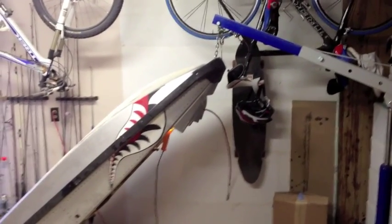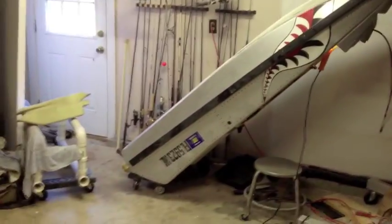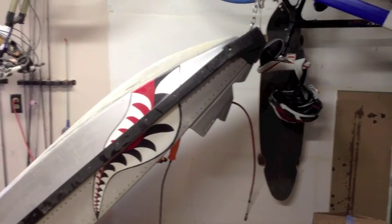I just wanted to get a quick shot of the rig I used to reinforce the inside — what would normally be the bottom side — of the handle pole bracket mount on the hull. I basically hung the hull upside down off of my engine hoist, put a furniture dolly under the stern of the ski, trying to get the surface as level as I could so I could do the best layup. That way I could sit on a stool and sand in there to get it all smooth, then lay the Kevlar so the epoxy wouldn't run off. Got that surface as level as I could — worked out pretty well.